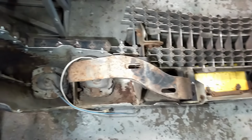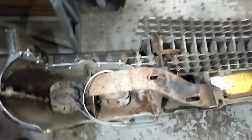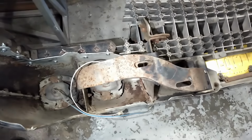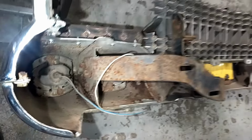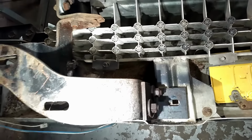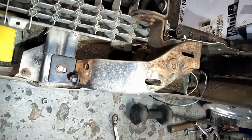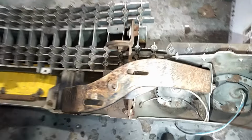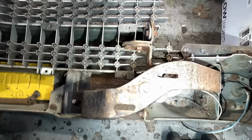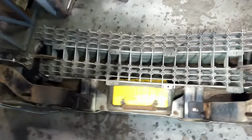So when you're bolting your 59 bumper onto your 61 Cadillac, you'll probably need to shift the brackets inboard. So you can see how they're bolted onto the outboard side here, and on the passenger side of the car I have it switched over to the inboard side. The bracket is completely moved over to the inboard side, and that'll let you get these slots close enough in to bolt the thing up to the existing frame and have the right fit and look.